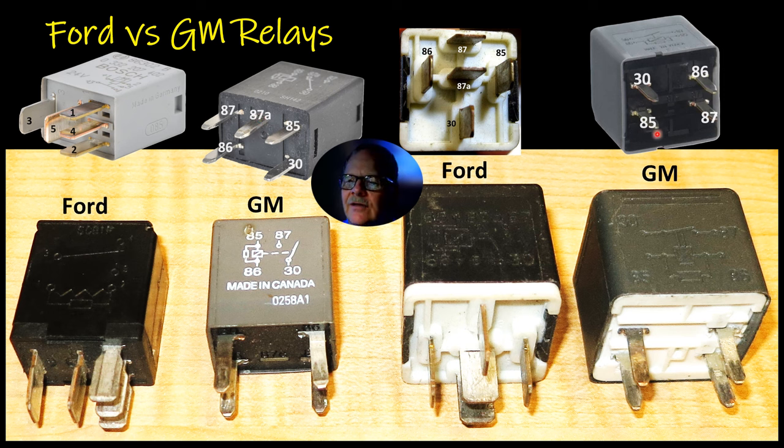Your other GM relay is like this one except it's bigger, and it's numbered 30, 85, 86, and 87. Now, 30 and 87 may be transposed on this, but it doesn't matter because it works either way. Furthermore, the relay coils are not polarity sensitive — that's why they don't have a clamping diode. If they did, you would burn something up when you plugged one in backwards. On a schematic, they show a little clamping resistor — not a diode — so that when that relay coil de-energizes, it doesn't create a spike that damages whatever controller is doing the switching. When that magnetic field collapses across those windings, it creates a high-voltage spike, kind of like an ignition coil though not quite as hot. You put a resistor in there and let it chase its tail — that's pretty well how that works.